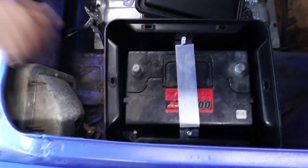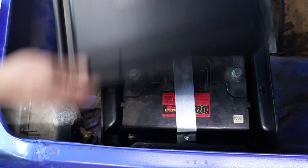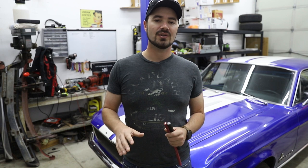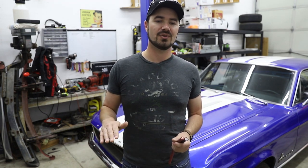Once I had the floor of the trunk prepared and I had the holes cut and the box kind of placed, one of the issues I encountered is the floor of the trunk's not flat. I don't have my false wood floor in here to flatten out the trunk. I want to make a new one so I didn't want to go through the hassle of bolting this through what I had on hand. So for right now, I'm bolting it just directly to the uneven floor, which is twisting the battery box slightly. That's going to be a consideration on how I mount it to ensure that I can still flex the box back and get the lid to seal properly on top. Later on, I'll use the same holes through the metal when I put the regular floor back in — I'll simply have a level surface to bolt it down to so that it doesn't twist during the installation.